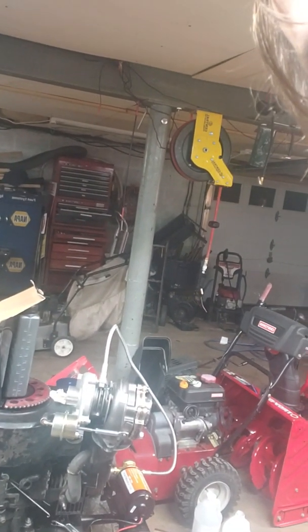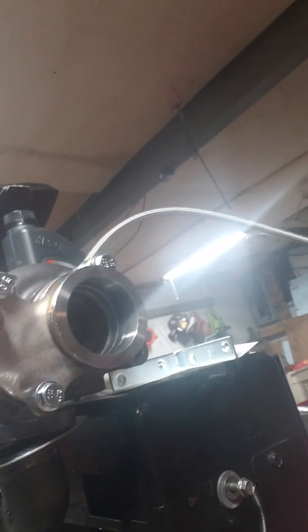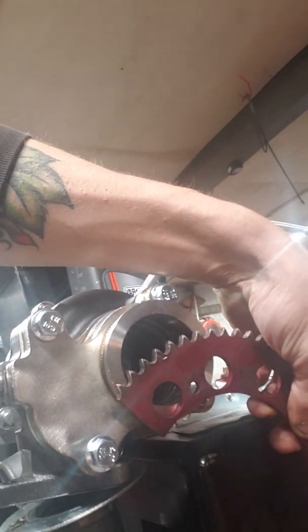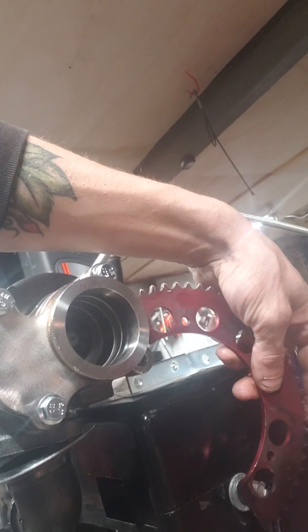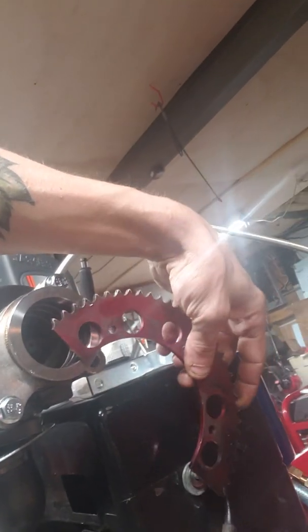Right now I'm backtracking, tearing the turbo back off, and securing an exhaust turbo bracket manifold. This thing's got all the weight of this turbo right now. It's currently hanging off of my exhaust studs down here. I did have a little bracket up here, but when I put this in, that made this old bolt hole not work.